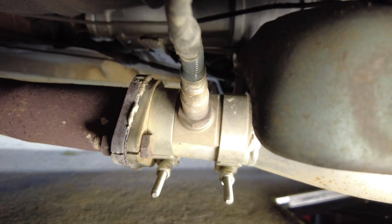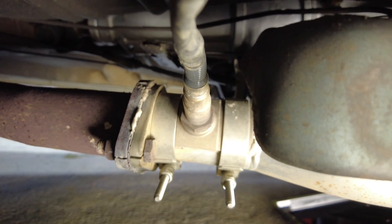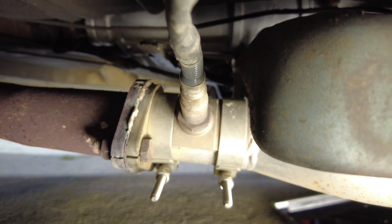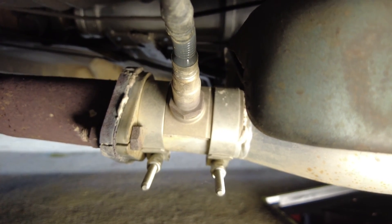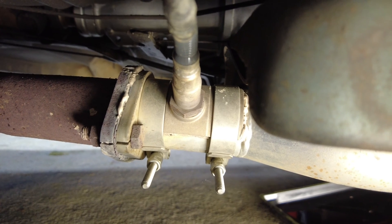The last thing that needed to be installed was the O2 sensor. The documentation asks you to install the O2 sensor only on one bank of cylinders. Being an inline engine, this exhaust system is a three-into-two-into-one, and I could have installed it a bit further upstream in the system where the three comes into two.